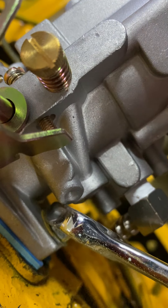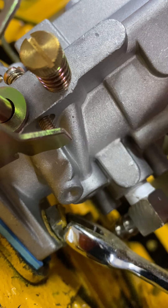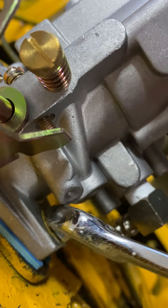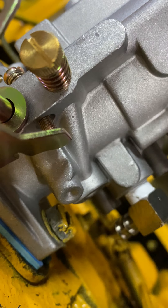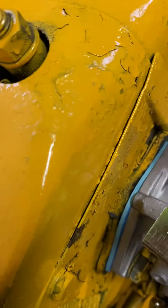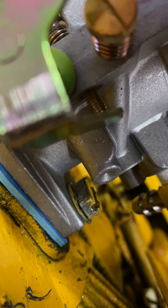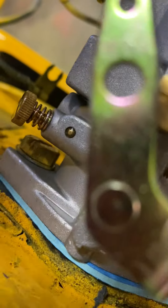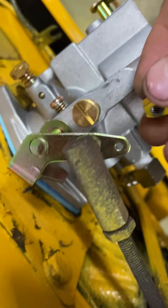That might work if I would tighten the bolt up. You may have to adjust your fuel inlet to line up with your fuel hose. If you have to adjust it, you can — it makes it really difficult when it's in a spot and it's still wet from paint. Okay, that side's tight. Put your gasket in, your throttle linkage pieces right here. You want to take this little nut on there — you want to take that off. That big hole is where it squeezes in, and you can thread this little nut in there underneath.